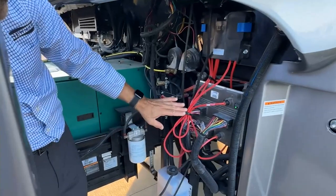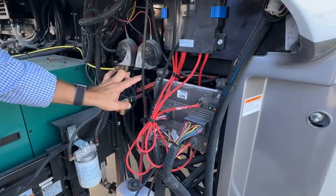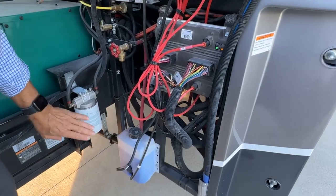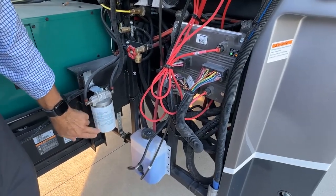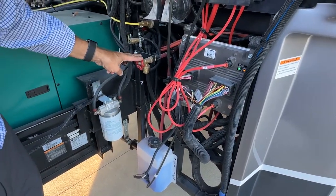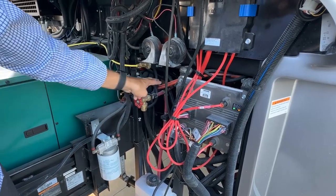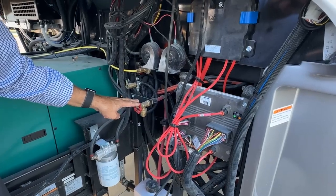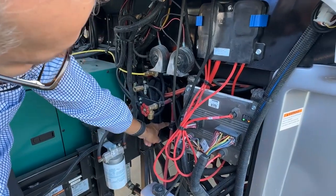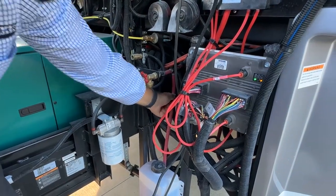We've got the chassis controls and modules. We've got our street horns here and wiper wash solution. This filter is for the ITR Oasis and needs to be changed yearly. We have our hot water spigot — the hot water comes directly from the ITR Oasis to the front end here. If you need to winterize this line, there's a drain right here. Just open this valve and that would drain the water out of the line for winterizing.